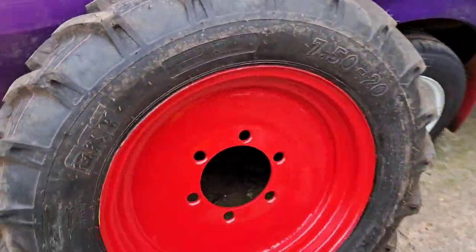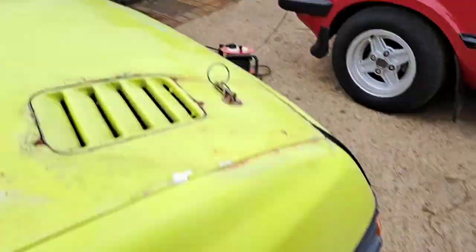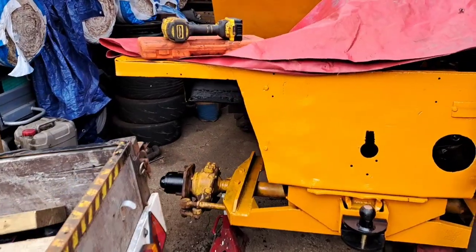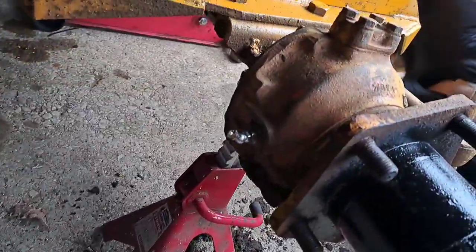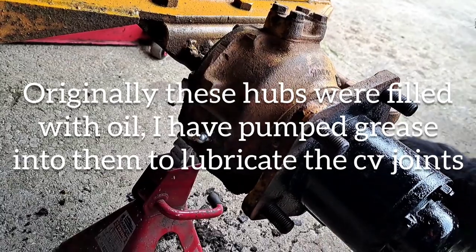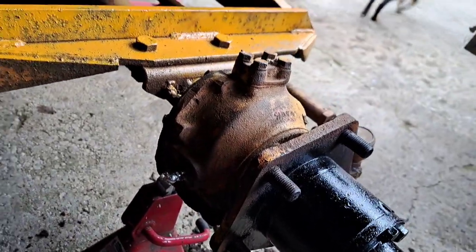I've done a front one as well, just round here - it's just drying off, so they should look quite good. She's jacked up in the air at the moment. I've painted the hubs up black and put some grease nipples in the hubs because I couldn't get the filler plugs out of the rear swivels, so I put a grease nipple in, tapped the thread in there and packed it with a fair bit of grease just to keep it lubed up.